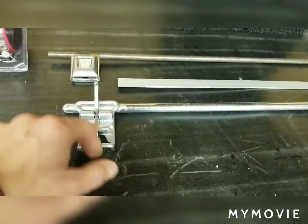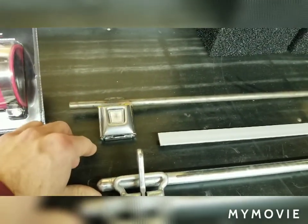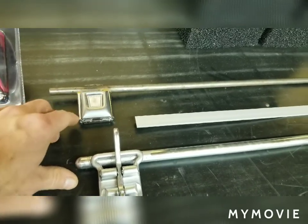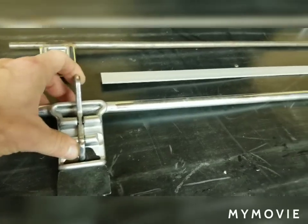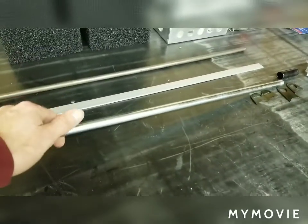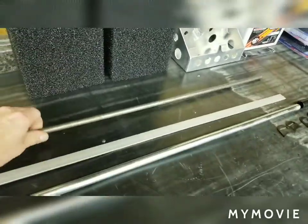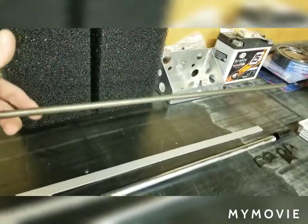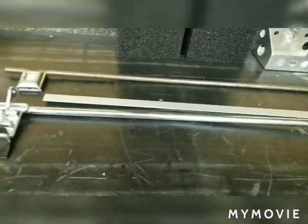But we move from that and we come over here. We're going to change the latch over because this is our old school window net latch, and the old seatbelt buckle works okay. It's just we had a problem in the last race where it didn't latch and it kept pulling off. So I'm going to go ahead and move to this one. Now the benefit of this is actually a hollow rod. So the weight of that versus the weight of this is a considerable difference. Like that might weigh 5 pounds and this might weigh 3 pounds. Anything to save weight is great.